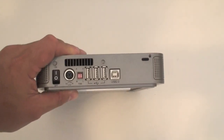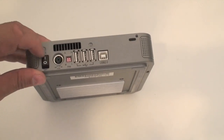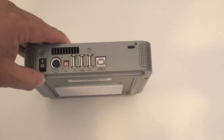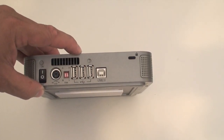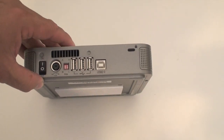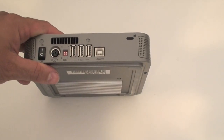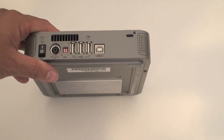On the back you have the USB ports, the power cable, and the power button. When you turn the unit on, you have to connect the USB cable that comes with it to one of the USB ports on the Mac Mini. The reason for this is so the enclosure turns on and off automatically when you turn on or off the computer — you never have to manually turn it off. Since it has the USB cable connected to the Mac Mini, it will detect when you shut off or power on the computer and control the hard drive accordingly.